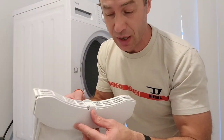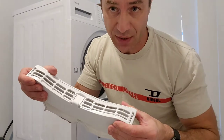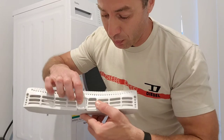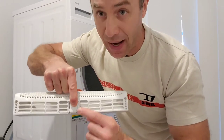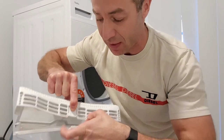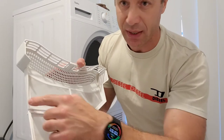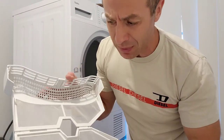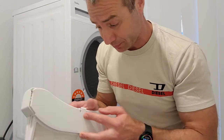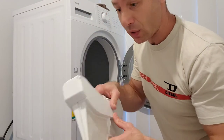When you're finished cleaning, close the two halves together and firmly push until it clicks — both sides as well, one in the middle and two on the sides. Again, pushing the latch down and the other up should open at least one side, then you wiggle the other side out. You won't break it; the only thing you can break is the connection in the middle, so be careful because that makes the filter non-functional. That's the top filter — smooth side going in, rough side out.